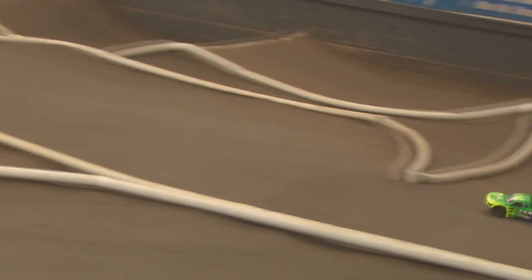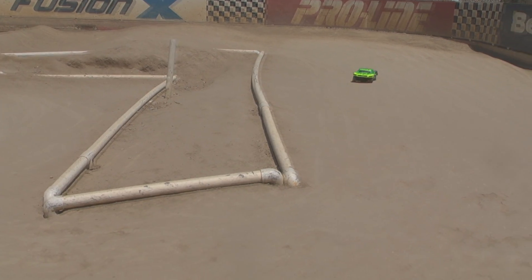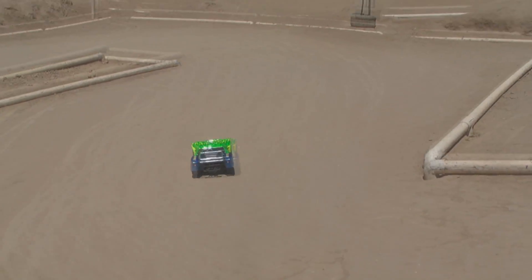When you don't have enough droop, the truck tries to roll, but as soon as the suspension bottoms out, it almost acts like a bump stop in the reverse direction. With this extra droop, you get a more consistent and manageable roll in each of the turns around the track.